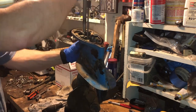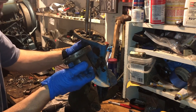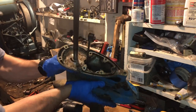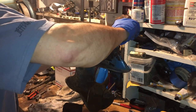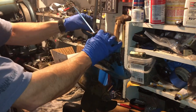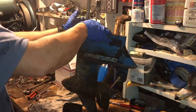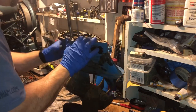A little nudge with the impeller, a little nudge with the rubber mallet. That plate is not bad — looks like somebody did some work. Then just your typical nasty salt corrosion — a lot of it. It's dirty, hasn't been changed in a while. I want to be careful with this plate because I don't have another one. I get my key out before I lose that. I have to get this pin out so I can pull the plate off — it's little, don't lose it, but I believe the kit comes with it.